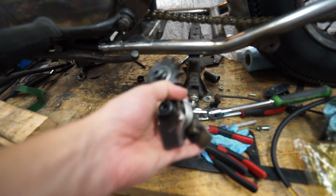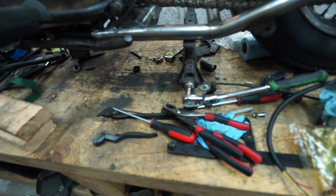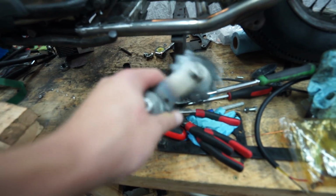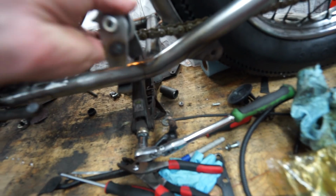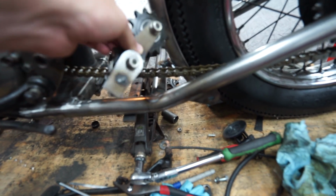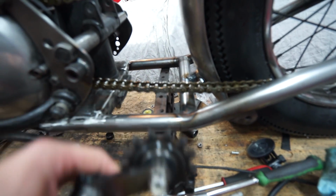So here's the chain tensioner I got. It's from Monster Craftsman. I'll throw a link to this in the description as well. But basically there's just a spring in there that's designed to create a little tension on the bottom of this chain. So the ideal spot would be to weld it on that crossbar right there, but with my fender being where it is, it would kind of get in the way. So I'm trying to figure out a way that I can mount this.